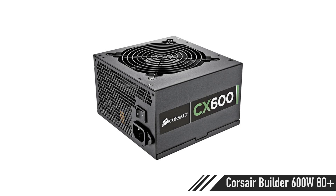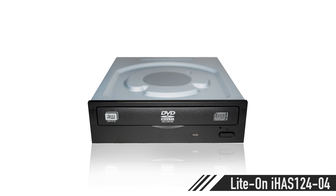For the power supply, the Corsair Builder 600W is 80 Plus certified — that's very important — and has a single 12-volt rail which keeps things more stable than units with two or four rails. That's around 53 pounds. For the optical drive, a LiteOn iHAS 124-04 CD burner is around 20 pounds, but if you have one from an old system or plan to use USB, don't bother.